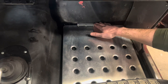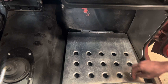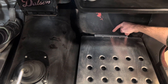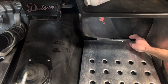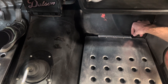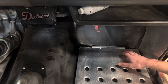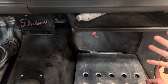With the back right corner locked down in position, I took a small diameter drill bit — eighth inch or so — and marked the four holes I was going to use by drilling them through. I like to do one at a time to make sure nothing moves. These come with M5 rivnuts in the hardware kit. After drilling the pilot hole, you'll need a bigger drill bit to fit the M5 rivnut through — I believe I'm using a seven millimeter. You want a drill bit that's the same diameter or very close to the outer diameter of the rivnut. Check our rivnut videos if you have questions on how to install those.